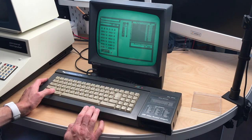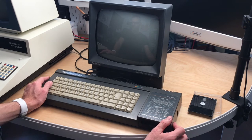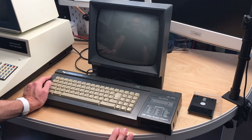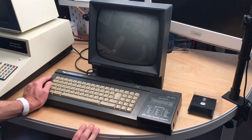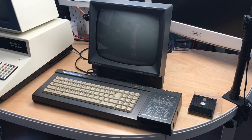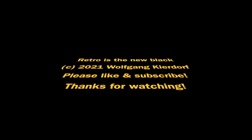This is the most common fault on these drives — the belt is just degraded. So if you can pick up one of these for cheap with a non-working disk drive, this is how you can fix it, and these belts are pretty much five bucks a bag of a hundred on eBay or Amazon, so grab them while they're hot. That's the Amstrad CPC 6128, or the Schneider CPC 6128 in this specific case. This is Retro Is Your New Black — if you are new to the channel please like and subscribe, thanks for watching and until next time.